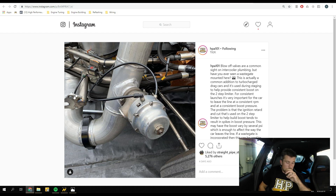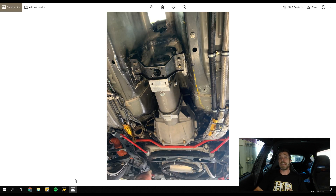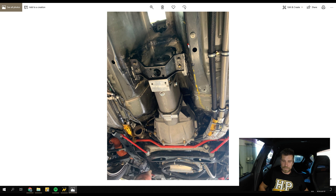For an update on our Toyota 86: if you've been following us over the last few weeks, you'll know I've been talking about the TTY 6-speed sequential box upgrade. It hasn't been as easy as we would have liked, and the car has been at our fabrication shop for the last couple of weeks getting that installed. Looking at the laptop screen now, you can see that some manipulation was needed to the transmission tunnel — some bracing had to be cut out of the factory trans tunnel to give clearance around the gearbox.